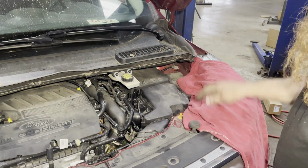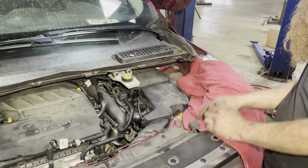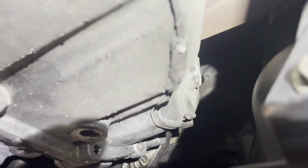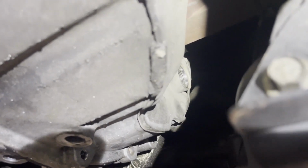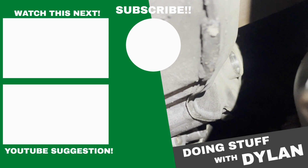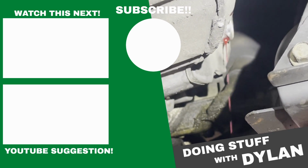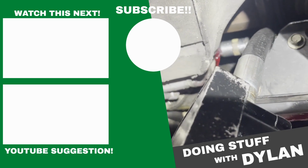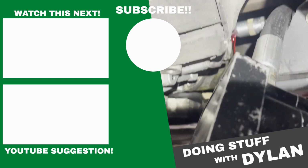I just fill it from down below. I'll show you guys. What you do is you just take this guy out. You fill it till it comes out. Then you start it. And then you fill it till it comes out again while it's running. And that's how you know it's full. It's running out now. Alright, now I'm gonna go start it. This is what it looks like when I'm filling it, guys.